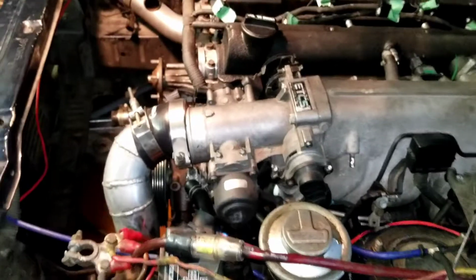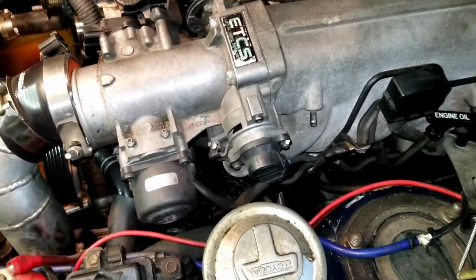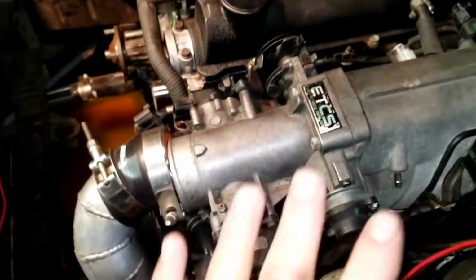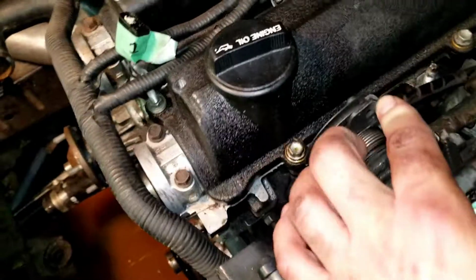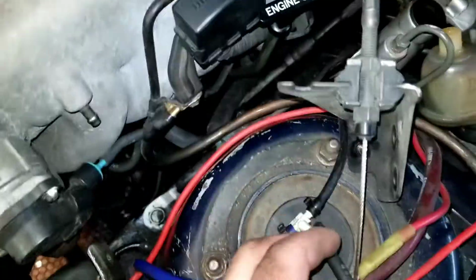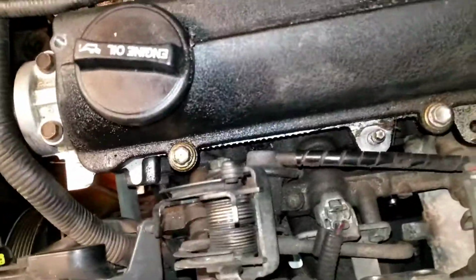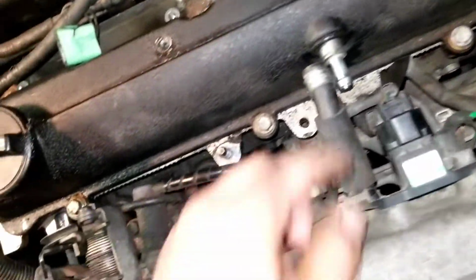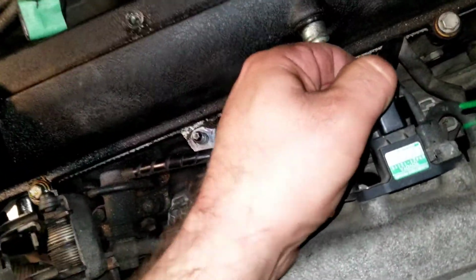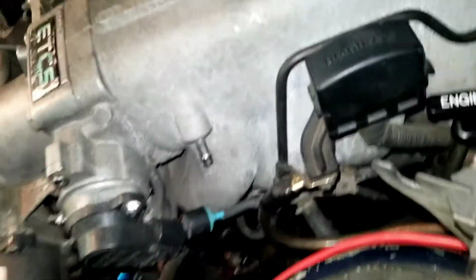So the exhaust side's giving me a lot of hard time. Yours might be different depending on what header style you have and whatnot. So I've moved over to the intake side. I've started to undo connections systematically, took the throttle cable off, moved the assembly over to the side here, undoing the hoses from hose barbs, getting down into that spaghetti, undoing all the connectors all down the intake, and hopefully the intake comes off pretty simply.